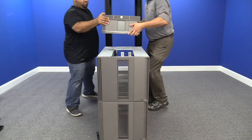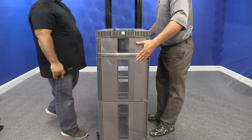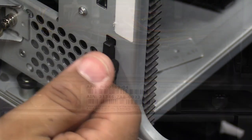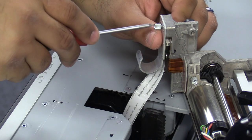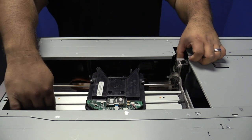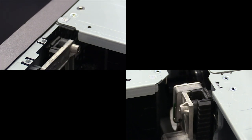Now that you have removed the defective control unit, you will replace it with the good one and then reinstall the picker. Put the replacement control unit into place, making sure it clicks in and is flush with the rest of the front of the library. Once it is sitting properly, tighten down the thumb screws in the front and back securing the control unit to the expansion below it. Then drop down both front and back picker tracks. To install the picker, first connect the picker cable to the rear connector of the picker. Then carefully line up the front and back wheels with the guide channels going down the tracks. Lower the picker carefully, ensuring that it is level front to back. The top edge of the wheel should be even with the top edge of the track for both front and back tracks simultaneously. If one wheel is either a bit above or below the edge of the track, pull the picker out and try again. This may take a few attempts. Please don't get discouraged, just take your time.